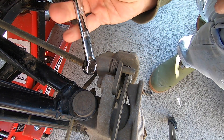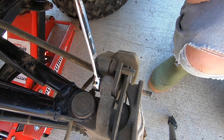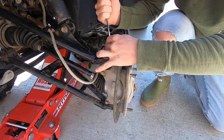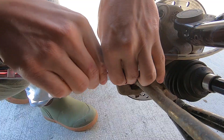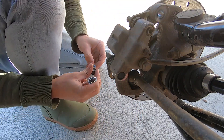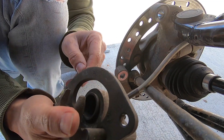For the meantime, you'll need a 15 millimeter wrench — at least for the Sportsman 850s — to undo these bolts. And you'll want to turn it the right way. And there we have our entire brake caliper setup.